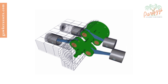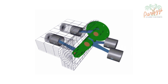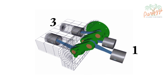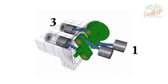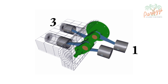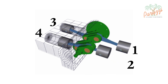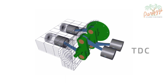We will first explain through animations the operation of the boxer engine. Here we show a schematic representation: in green is the crankshaft, blue are the connecting rods, and the pistons are gray. Keep a close eye on cylinder 1 and cylinder 3 — they are moving equally, performing the same motion at the same time. If one moves toward the cylinder head, the other will do the same. The same is true of cylinders 2 and 4. When the piston reaches its farthest point closest to the cylinder head, we say the piston is at top dead center, abbreviated as TDC.